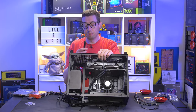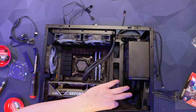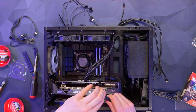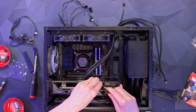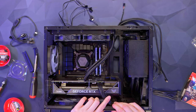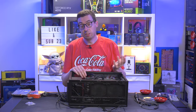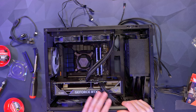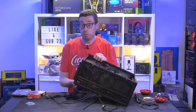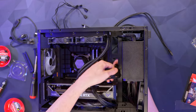Now it's just wiring things together. The 12VHPWR cable comes up from the bottom with a nice clean run, going over and clipping in. Tucking it down with a nice curve on the cable — no cable combs but with zip ties you can get it looking clean. Then the 24-pin ATX passes up and through, and then down into its connector. Also plugging in USB 3.0 — that needs to bend around to reach its connector — and the USB-C header which also needs bending around to fit.